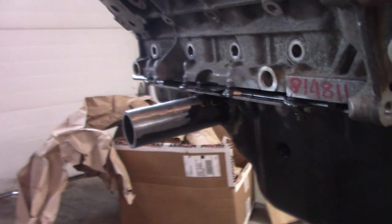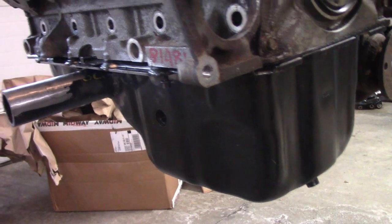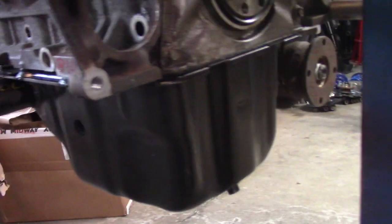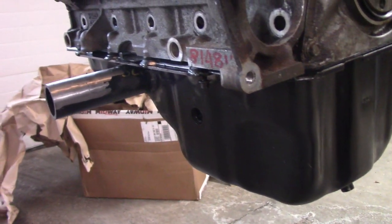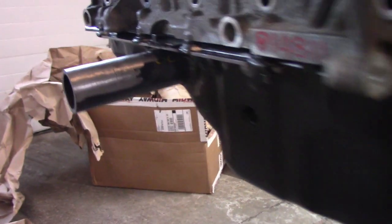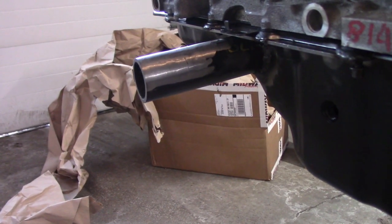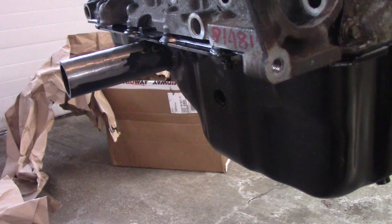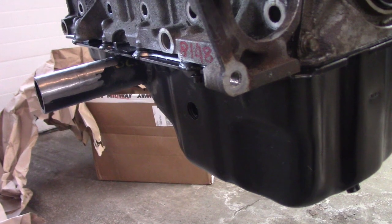As you can see, there's a shaft — there'll be a shaft going through the oil pan. I'm going to redo this whole thing again; this was all meant just to be a proof-of-concept oil pan. Basically, the differential bolts to the oil pan slash block. There'll be a shaft going through the oil pan that barely clears the crank, and there'll be a bearing assembly over here that will support a jackshaft with a CV joint on the other side — similar to a lot of four-wheel drive cars. Not anything new; the fabrication is just the tricky part.